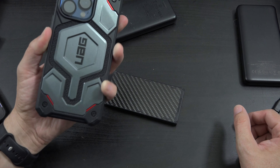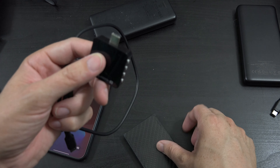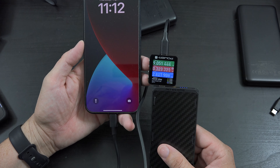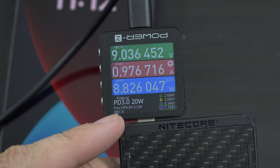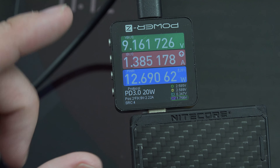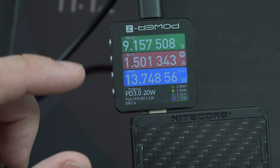My phone is at almost 70%, so it's not going to charge that fast. I'm plugging in a power tester and then my phone. As you can see, it's capable of up to 20 watts. As your phone battery becomes full, it slows down and charges at a much lower rate than it would if your battery was low. 20 watts is actually fantastic. Now, this phone is capable of charging up to 27 watts, but this charger is only capable of 20, so we won't hit the phone's highest speed — but I'll be damned if I say anything negative about 20 watts. That is fast and it'll get your phone full in no time.